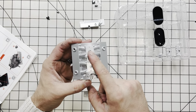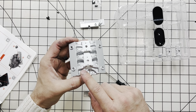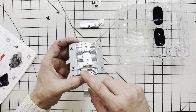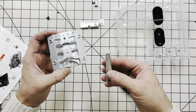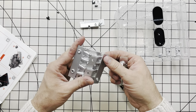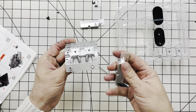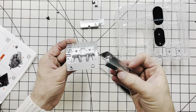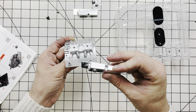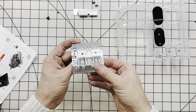Looking at it, check one side doesn't have anything. The other side, we have markings here. So on a Ford engine, the distributor will be up here, so that's going to be going towards the front. That way you know exactly where to put these. So flip it to this side. Now look at this piece — this will be the passenger side, this will be the driver's side. So valve cover, the center bolt will go towards the top. There you have it, just like so.